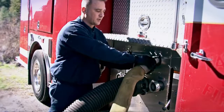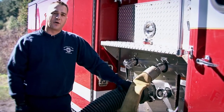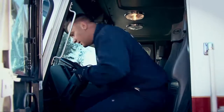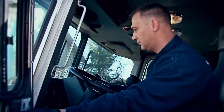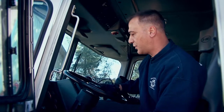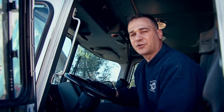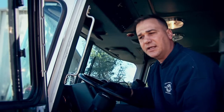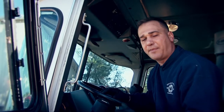Now we've got this all hooked up. Our next step is to crank the truck up, let it get to a nice operating temperature, and see if we can pull a prime. We had this truck running a little earlier so we're already at operating temperature. Also, you want to have all your emergency lights on, and if the truck is equipped with a PTO generator, you want to make sure you're running that also. The PTO generator will take horsepower away from the motor, so that can affect your pump test. It is required by new NFPA standards to have your apparatus emergency lights on, and if equipped with a PTO generator, you want that running too. This truck isn't equipped with a PTO generator, so we're just going to operate all the emergency lights and start the pump test.